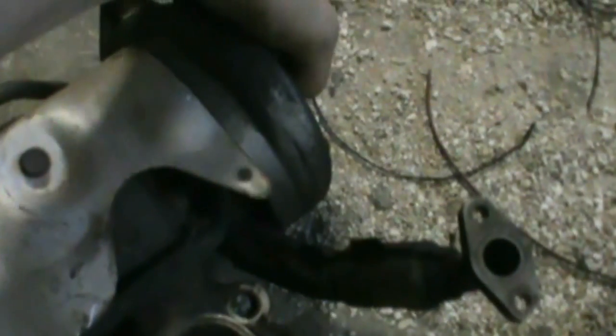While those are soaking, I was thinking about my turbo situation. You can see this one is freaking screwed — that's the primary. I still have to take that one apart just to check. On this extra pair of turbos from the parts car, the primary has quite a bit of lateral and horizontal play so it's no good. But the secondary turbo only has a little bit of side play. So I could probably take it all the way apart, switch over the compressor housing so it's the front one, and use the CHRA — the center housing — from it. I should be able to make a decent pair of turbos for now until I can get a good hybrid pair made.